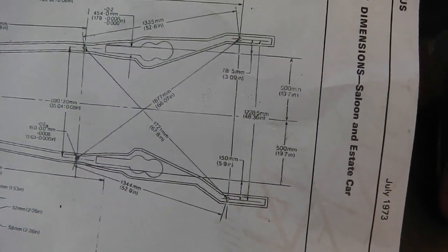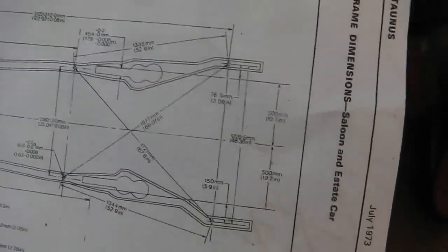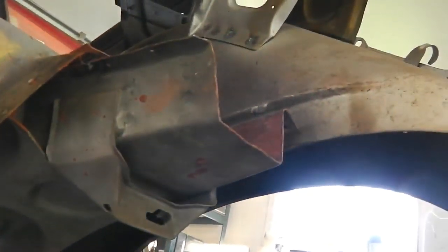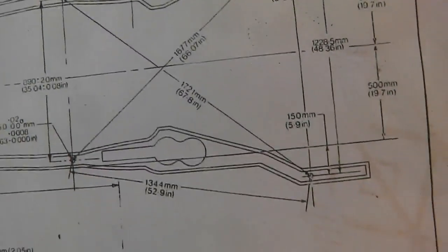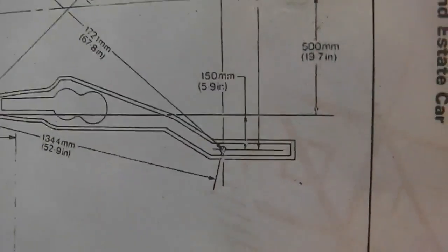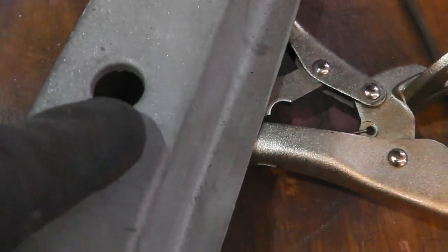And when I say chassis legs, in this instance I'm talking about the ones which weld under the boot floor, not the actual axle ones which we've been talking about. So these are in another section. These sometimes are supplied with them on eBay. I've seen them new old stock with them fitted, and also I've seen them without, but it is all a single piece. So we're looking at 172 across from the driver's side locating hole, the end of the chassis fork, across to the locating hole on the... here it is. So you never wonder what that's for.